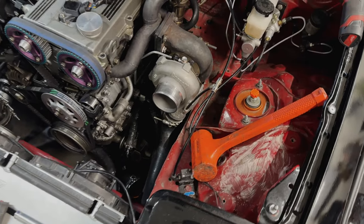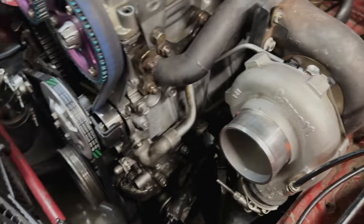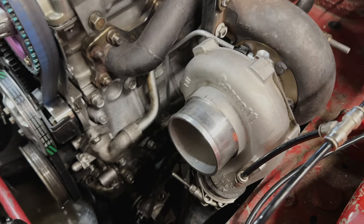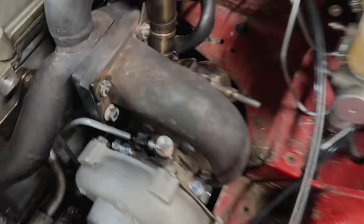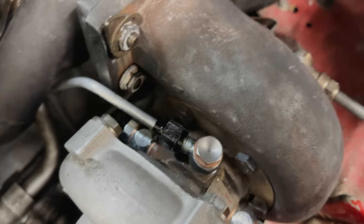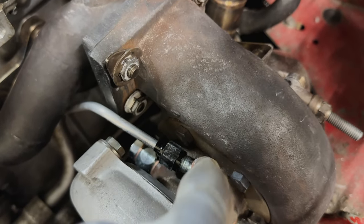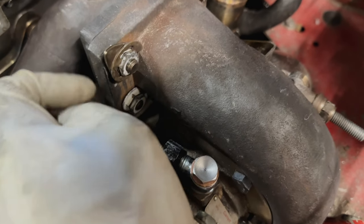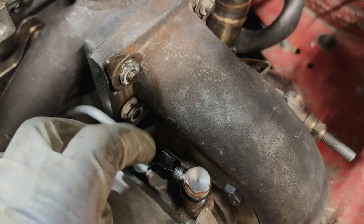Well, we got good news and bad news. Good news is the coolant lines look like they'll probably work out. I haven't gotten them in yet, but they at least line up and fit. These fit the edge of these like they're supposed to, but the oil feed, which is -4, doesn't really agree with that, which is interesting. This is -4. The silver piece itself, I've tested with other -4 items. It's just this that does not seem to line up with anything -4, this side or the other side.